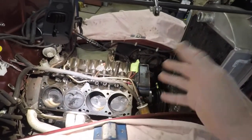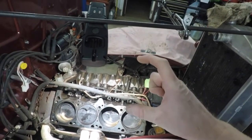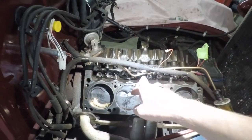Right now we're trying to get to the bottom of a noise in the motor. I'm going to put up a playlist from this vehicle because we've talked about this in previous videos. The short story is that as soon as dad put a new cam in that 340, we started getting some noises. This is the motor all torn down now. When we put the cam in, it's got taller lobes — it's going to push the valves open a little bit further.